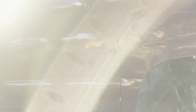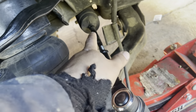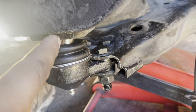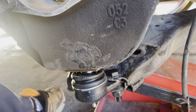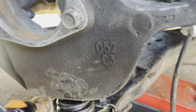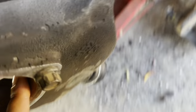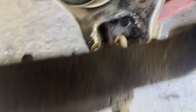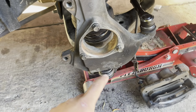Let me show you guys — here's the new upper control arm, new outer tie rod, new inner tie rod. This is what I'm talking about — this is supposed to be the other way. You can see there's a little space there, it is fully seated, it's just the boot needs to go all the way down. On these particular trucks you can replace the ball joints but you just need to get rid of the rivets. You have to drill out the bottom spindle — the ball joint did go in here but you have to drill it out. It does correct it, as you can see it's pretty straight, but you are putting a lot of stress on that ball joint.